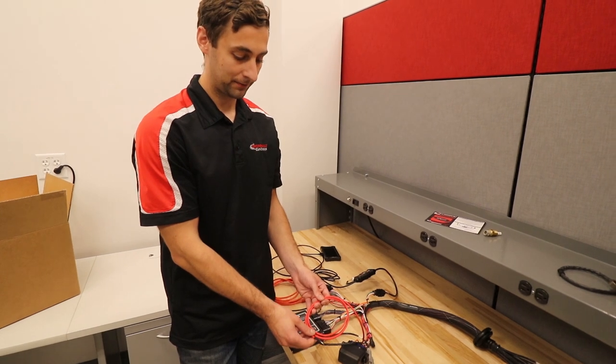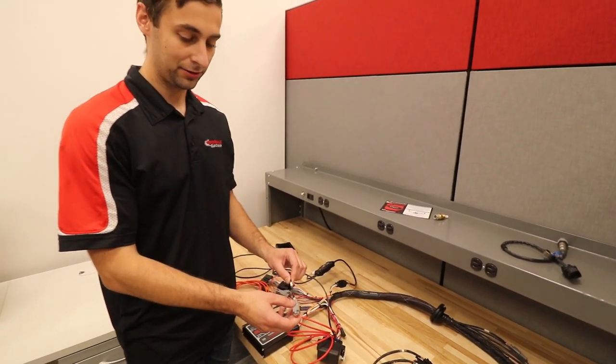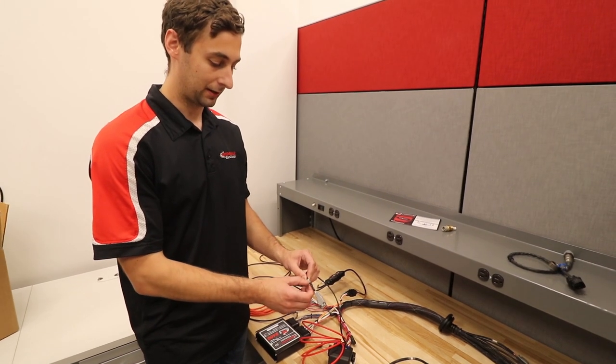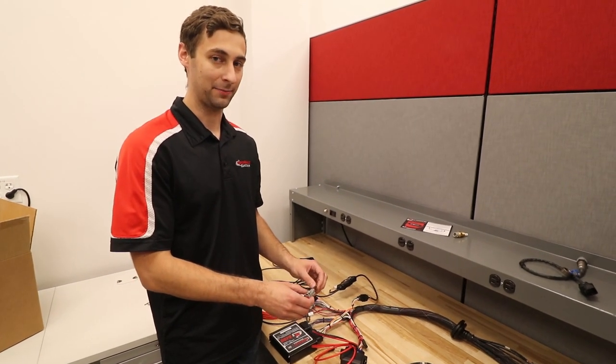This is the main power wire with a quarter-inch ring terminal. It should go directly to the battery, or in the 944 application it connects to a lug on the bottom of the factory fuse block on the driver's side. It's easiest to unbolt that fuse block, take the cover off, and access the lug for your 12-volt power. The final connector near the ECU is a 2-pin DTM connector with a TAC output — a pulsed RPM output you can program in the ECU for your dash — and a vehicle speed sensor input. The factory 944 TAC connection is in the passenger footwell.